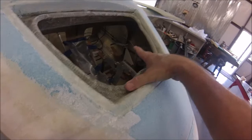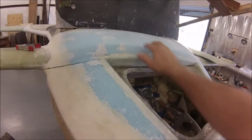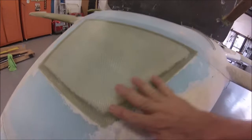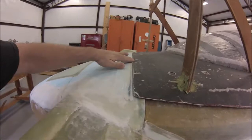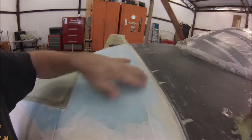I still have yet to figure out a way to secure my panel down. The aft part of the panel is going to fit on this little ledge here and then be glassed over like the plans indicate, so there won't need to be any screws at the back of the panel. But I will need two screws — one here and one here. I've got a pretty nice gap right here. What I did was just do a flox corner so that whenever I glass over it, all I'll have to do is trim it. So flox corner there and I know that edge will be fine.